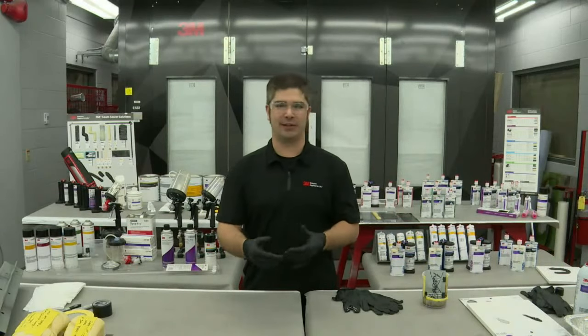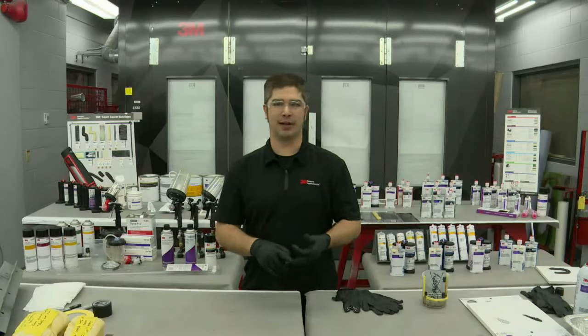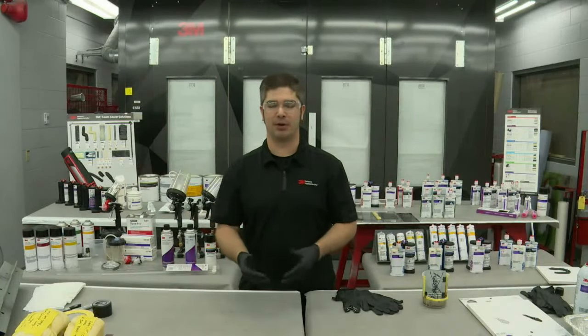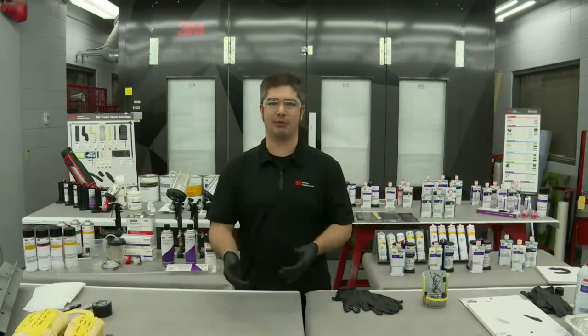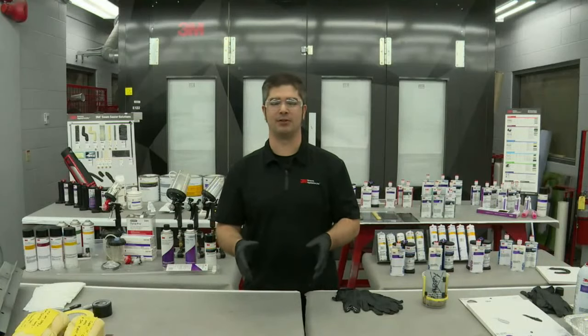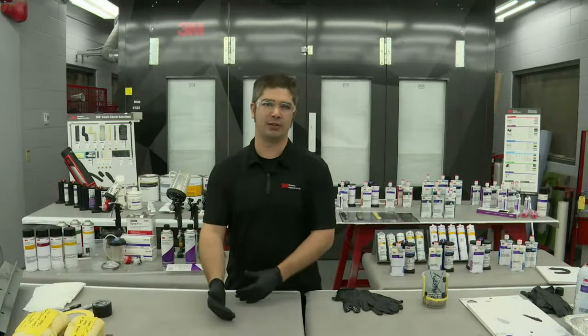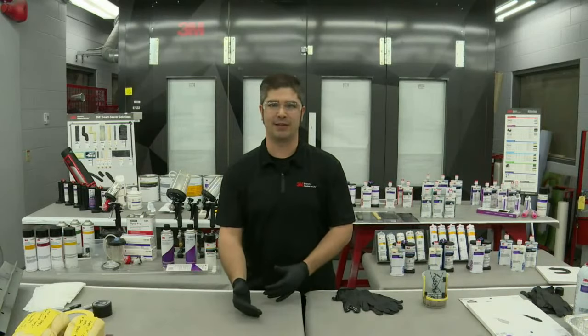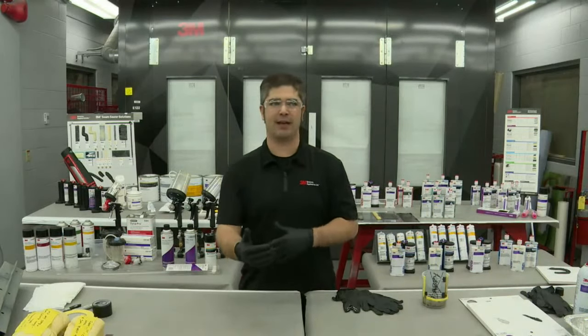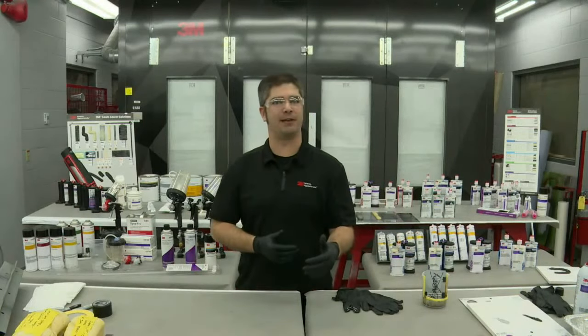as long as you're not fixing bumper covers, replacing headlights, and working on just miscellaneous plastic parts, as long as you're doing any type of repair that includes hammering, cutting, welding, paintless dent repair, anywhere where the E-coat is disrupted and disturbed, technicians should be using one can per technician per week. So if you're operating with a shop of 5 guys, right, and you're meeting sort of that average efficiency across the industry, you guys should be going through about 5 cans a week.